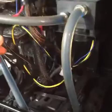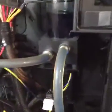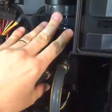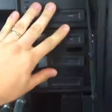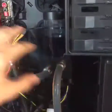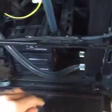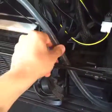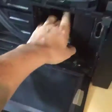I'll be revamping the tubing. I've just ordered some hardline tubing and a bay reservoir. The pump and bay res will go up at the front, so that area will be free. All of this soft tubing will turn into hardline tubing — the fittings and tubing are on the way. I'll also be putting a drain valve down at the bottom, coming off the radiator.